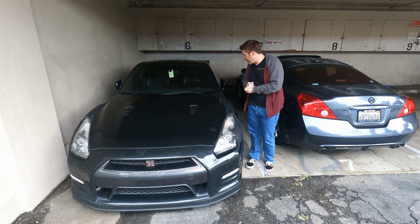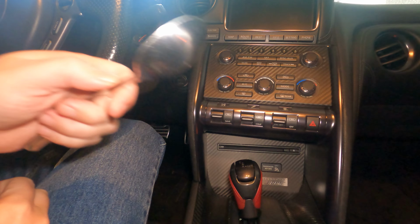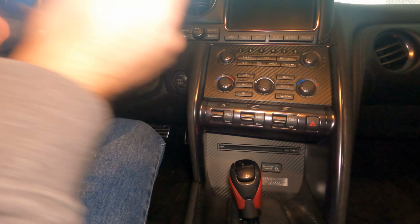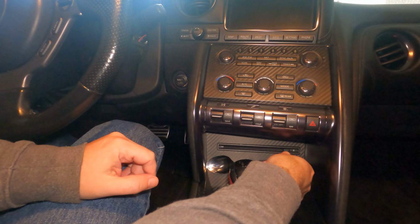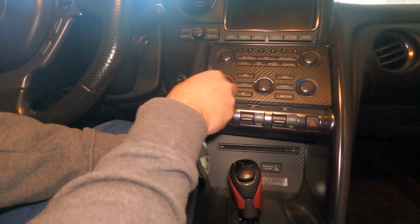But with that out of the way, let's go ahead and get that radio and AC control out of the car. So to get the side trim off, this is what we're gonna need the spoon for. If you had interior trim removal tools, it is better, but I don't. It's real easy. You just kind of give a little push and it gets right in between the trim and the actual stereo. Kind of work your way up, comes loose,